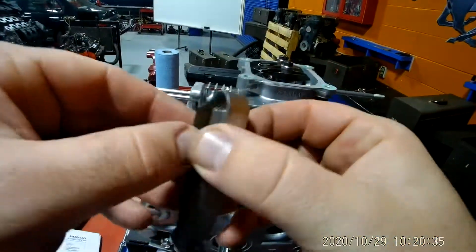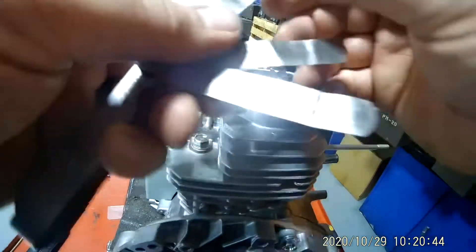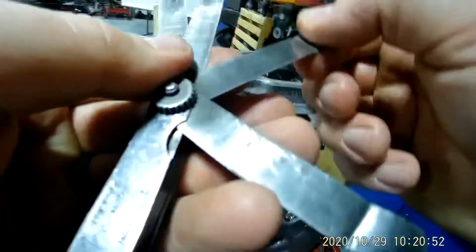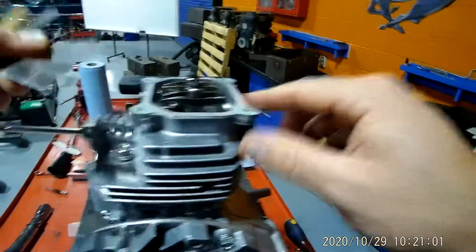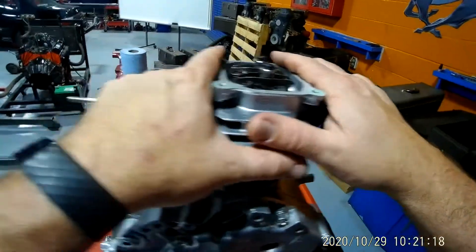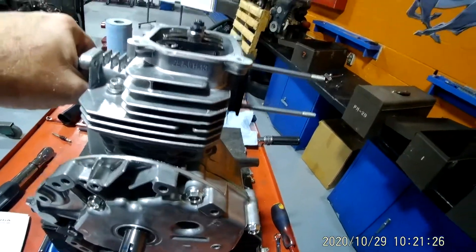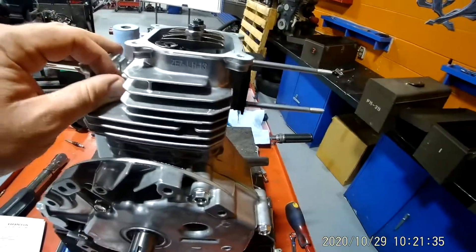After I get them all torqued down to spec, I'm going to go through and check them one more time — make sure you got it right. Six thousandths feels pretty good there; eight thousandths even feels a little better, so that should be right on. Now I need to go to the other one — go to six thousandths and check. That's a little tight; four thousandths fits a little better. That is how you adjust valves on this engine. Take your time, get it done right. Assembly goes a lot slower than disassembly because you have to torque all your nuts and bolts down and do all your clearance checks. Let me know if you have any questions. Thanks for watching.